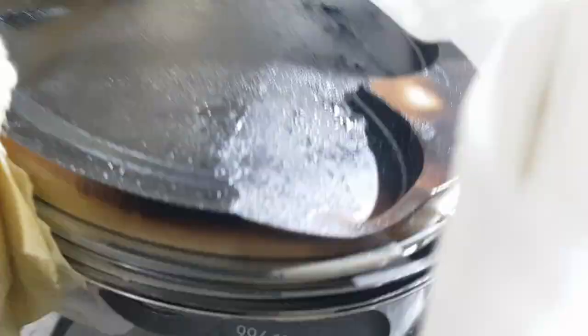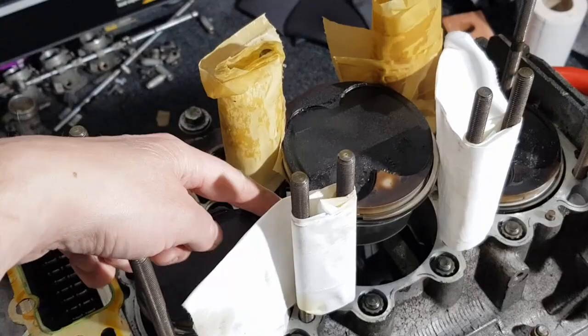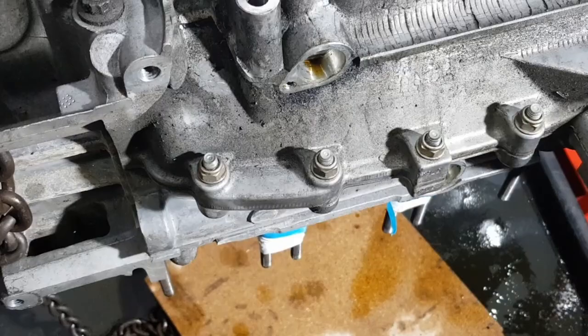The pistons are removed by taking out the circlip. You'll see there's a circlip in there that needs to come out. I'm removing the one furthest away from the flywheel end and then pulling the pin out. I'll remove this one, pull it out, spin the engine over to get to the next one, do the same, then rotate the crankshaft slightly to get at the others. Once those are all pulled out I can move on to removing the top crankcase half.